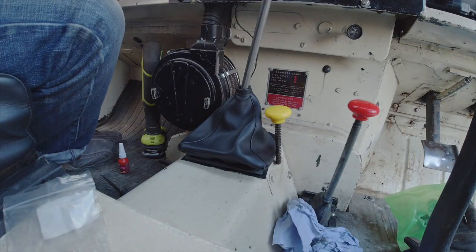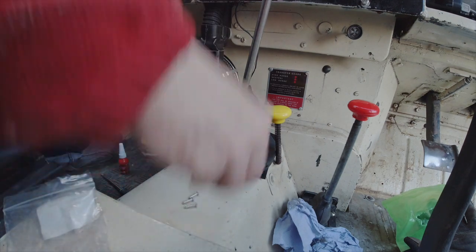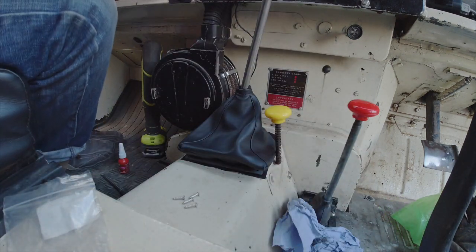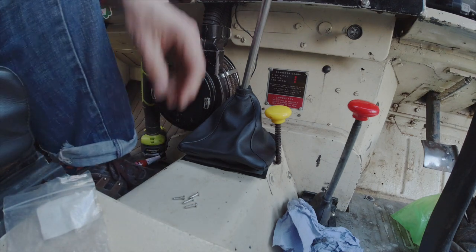At the front, the screws will go through not only the metal of the tower but also the back of the front of the bulkhead. So remember that when you're putting the screw in. If you put a drill hole that's too tight, you're going to struggle to force the self-tapping screw to cut through both layers of metal. So make sure you drill a hole that's big enough.